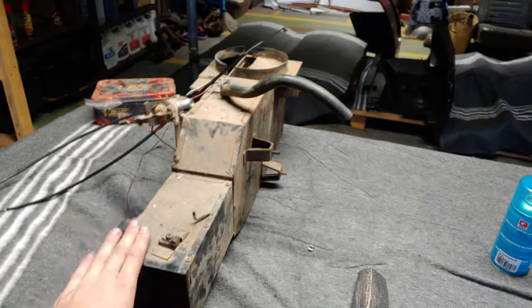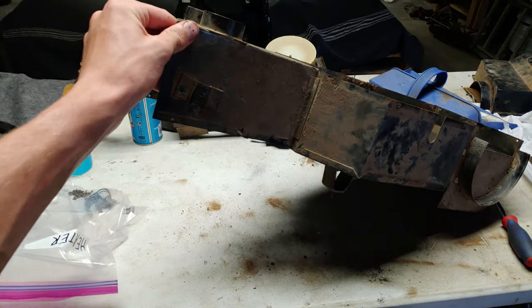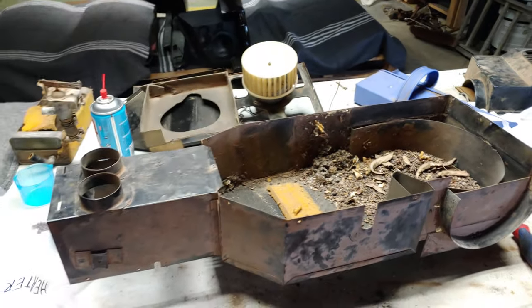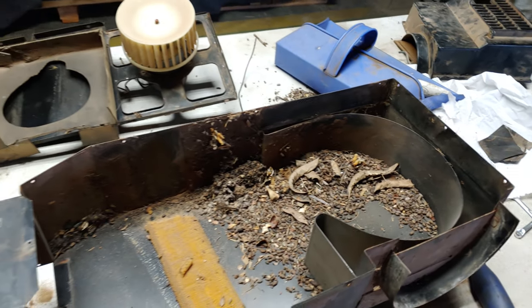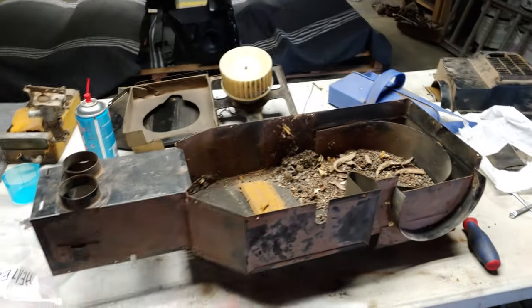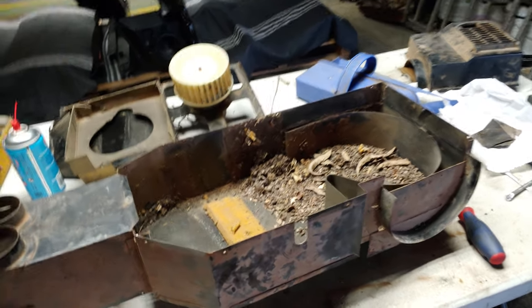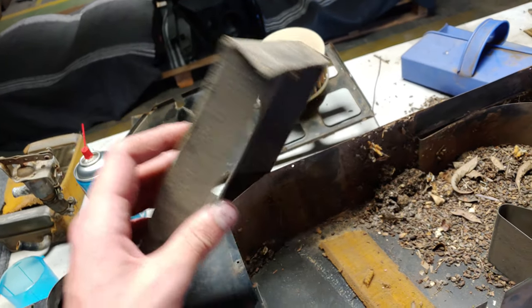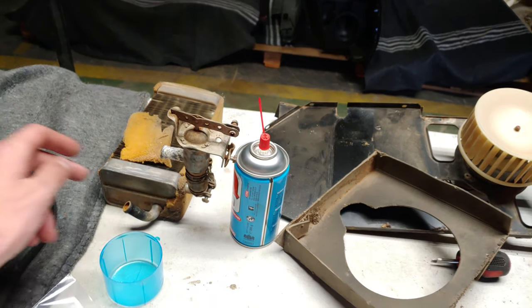Anyway, now we'll get on to this baby. I actually forgot the GoPro's memory card in my laptop at home so no time-lapse, but here it is disassembled. It just has like two panels you can remove, and you can remove the heater core. As you can see it's quite disgusting — a rat decided to make itself comfortable in here for god knows how long. I'm gonna clean this out and then sandblast this entire thing, being careful not to blast it apart since it's quite thin sheet metal. I'll probably remake the cardboard piece later and soak the little heater core in vinegar to loosen up all the gunk that has solidified inside without damaging anything.